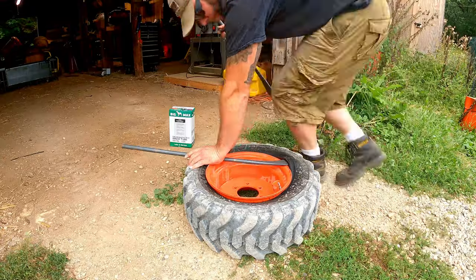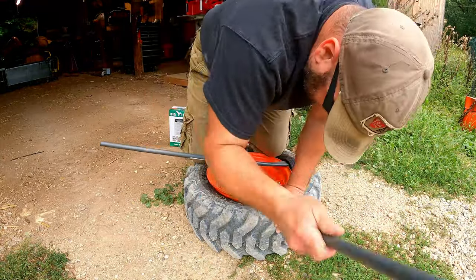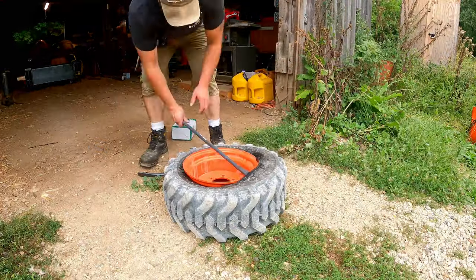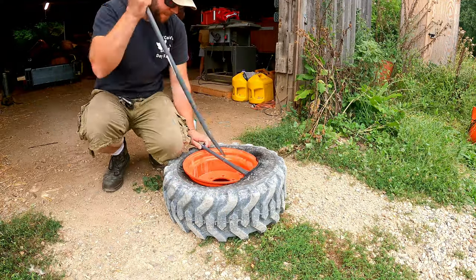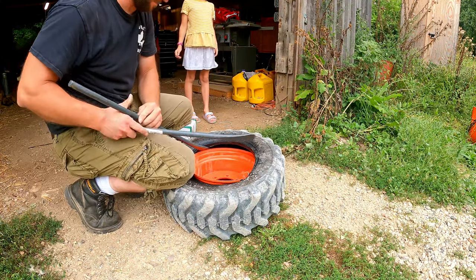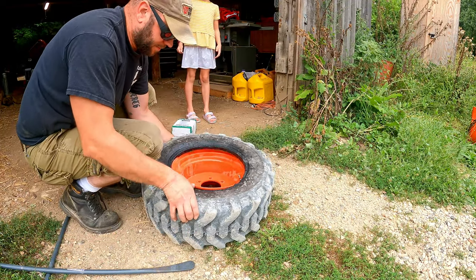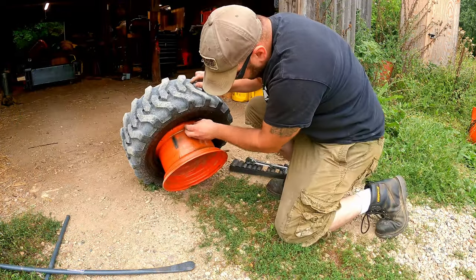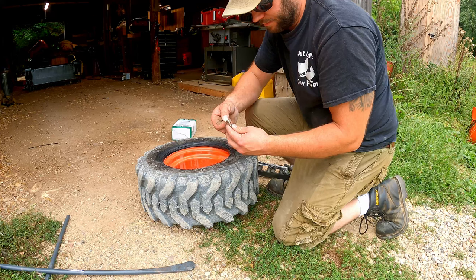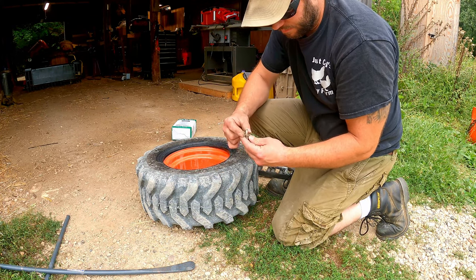The fact that the bead was already popped off the rim made this process so much easier, because popping the bead can be kind of a pain. So all I really have to do now is get the top side of the tire over the rim — I can leave the bottom side on — I just need to be able to get the tube inside the tire. I'm only taking the half off. Now I can remove the existing valve stem from the rim; this style comes out really easy — there's just a nut on top you loosen and it pops right out. Super simple.